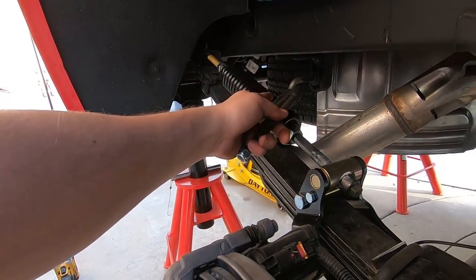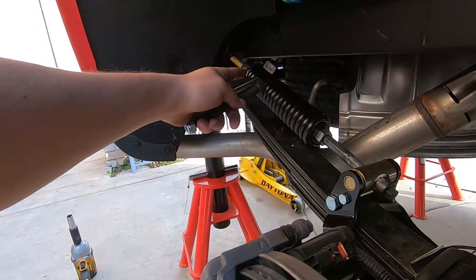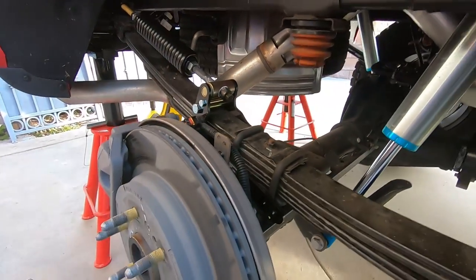When we start tightening, we're going to get the feeler gauge and go 25 or 40 — today we're doing 40 — and crank this up, then set the lock nuts to hold it in place. That's literally it. It's just making a couple of adjustments, throwing the tire back on, going to the other side, and then hooking it back up to the trailer. This is more about measurable data. I want to give you guys an idea of how much it's going to lift the truck so you can go home, get a floor jack, and take the same measurements.